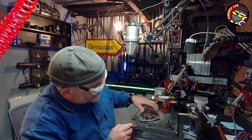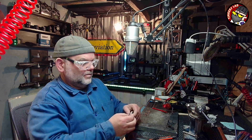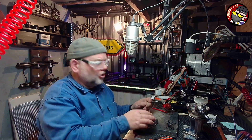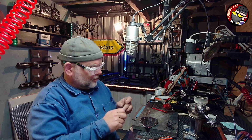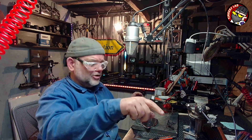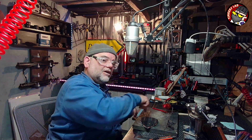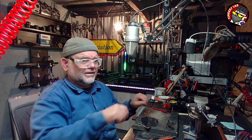I'll have to show you how to create a carpet pattern. It's like you're scribing a piece of wood, but effectively you scribe your carpet. So use a piece of wood like this, put it in the middle of the room, a bit bigger than that obviously, and you have a stick with a point on the end, and point it into every point you want to mark on your carpet, then draw a line neatly around that piece of wood. Then you do another one, and another, all around that piece of wood.